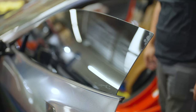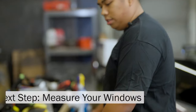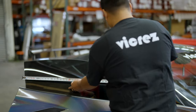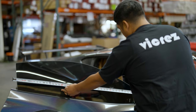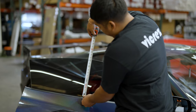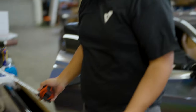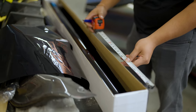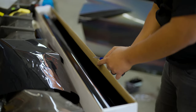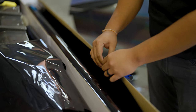The way I measure the glass — we have a 60-inch roll here — is from your longest point to the edge of the other side, which is about 40 inches, and top to the bottom of the window trim is about 13 and a half inches. Because we have a 60-inch roll, we can cut out both windows at once. You go up to the 13 and a half or 14-inch mark, put your blade in, and when you pull out the film you can cut both out at the same time.